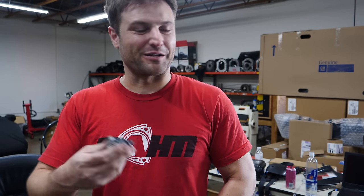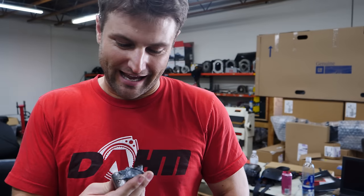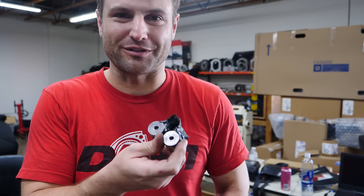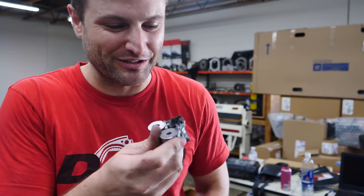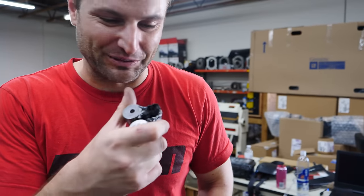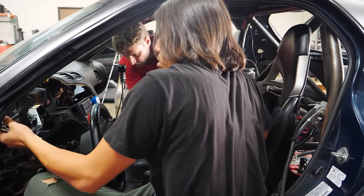Andrew, the one that has been helping wonderfully with the whole flat bottom, is young. He's new to this, and he didn't know that JB Weld has the steel and then the hardener. He's like, I put the steel on there. And so I told him, no, it's epoxy, it requires combo. He ended up doing it right, but he left the original part. And this matters because my carbon fiber cowl is not sticking to it. So we're gonna set the carbon fiber cowl aside, just throw the AEM dash in there and zip tie it.